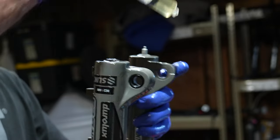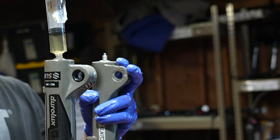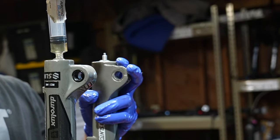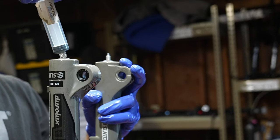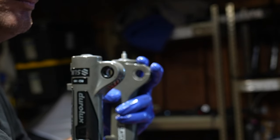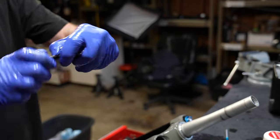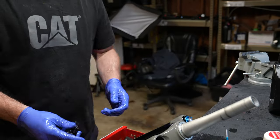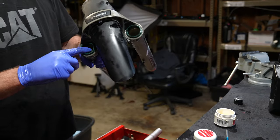This is the wild west with no official instructions, so keep that with a grain of salt. If you put 10 cc's of lower weight oil into the lower legs it will puke out of the seals and make a massive mess, but it will make the fork quieter. I found a document saying the fork can take 10 cc's of oil but you're supposed to drain it at that point. Basically add 2 cc's of oil through the bleeder valves at a time and then drain it when it gets to 10.